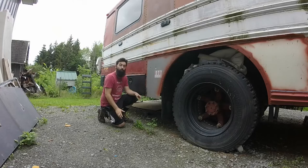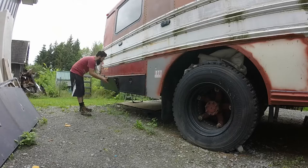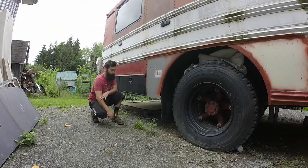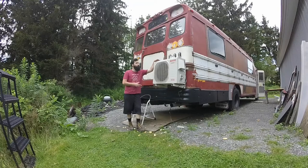We also put in a large toolbox — it's a contractor truck toolbox — and this is going to work great as a storage bin, really nice. It was pretty easy to install. It fit right between the skirt and the muffler, so we pushed it up on a jack, screwed it in with some big legs into the floor cross members, cut our opening, and it looks really good.